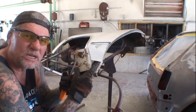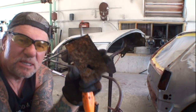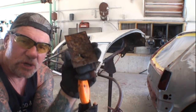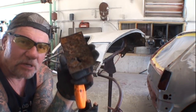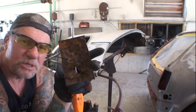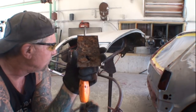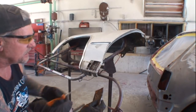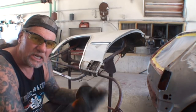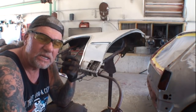What we got here is a little bit of rust, right here — look at the back of that panel, do you see that? That sucks. What we're gonna do today is I'm gonna show you how to treat that rust. I can't guarantee it's gonna kill the rust 100% and get rid of it forever, but we're gonna treat that rust and protect it — convert it into a black primer. Very simple, very easy, and very cheaply.